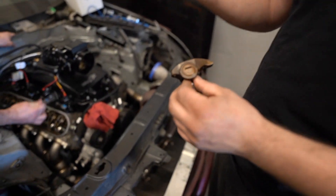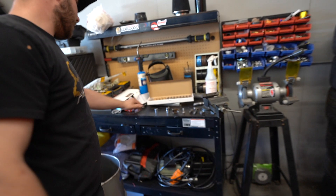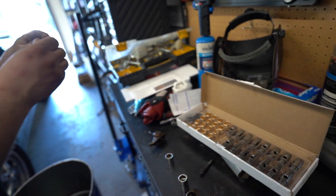It's a stock bottom end — you can't rev them high or else it's going to blow. These have a rollerized bearing in them and you're upgrading to a bronze bushing. That's pretty much it. How much are they? 150 bucks — so they're not bad for all of it.